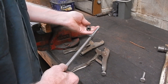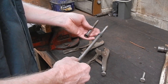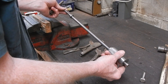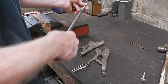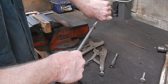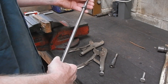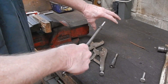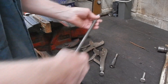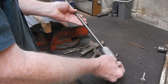You can even go further again. You can make an adapter with a T-head or a hook which would screw onto this and allow it to be used as a normal basic slide hammer to get behind things. That's what slide hammers were designed for — some have a gripping head which will clamp onto stuff, or you can just have a hook on it which is handy for ripping stuff off. You can even make up an adapter to go on the flywheel of a small stationary motor, screw this into it, give it a whack, and knock off the flywheel. A lot of things you can do — this is a very, very handy bit of gear.